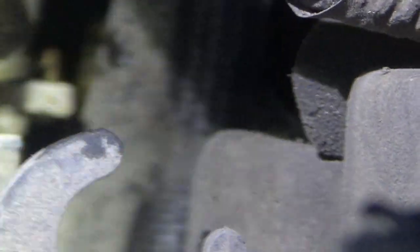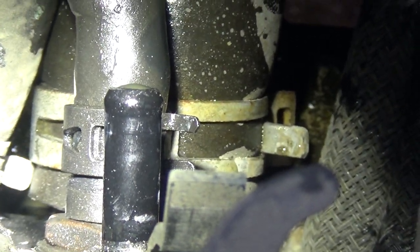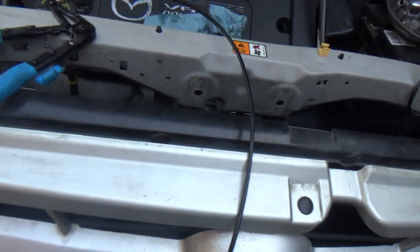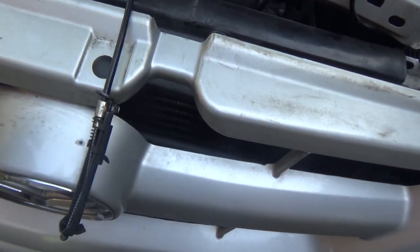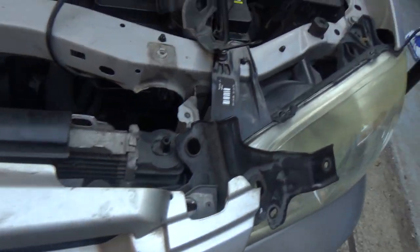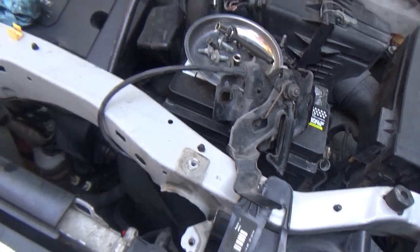All right, guys, so this is where you want the right tool for the job. If you can see that smaller hose, let me zoom past that one. Where are we at? You can see that clamp. Hopefully you can see it. Do you see where the little nipple's sticking out? I've already got that hose removed. The hose right below it. The clamp is on the outboard side. And there's no room to get pliers or anything on it. So that's where one of these little units come in. Very nice to be able to just reach down there, put this on the clamp, and then you squeeze this with the other hand, and it compresses that clamp. And it locks so that you can work the clamp off. Highly recommend one of these too. So that's my next little challenge.